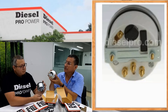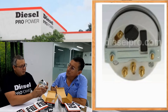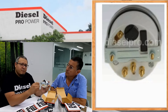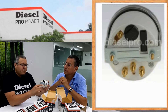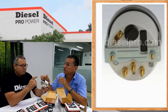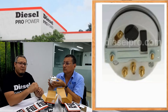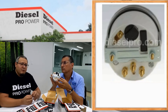And this one is the electric tachometer — that's right. This is an electric tachometer, also marine-grade. When you visit our website, dieselpro.com, you'll be able to see the instructions on how to install it. It also comes with a light bulb, and we can calibrate it as well — either with the reading from the magnetic pickup or the signal from the alternator.